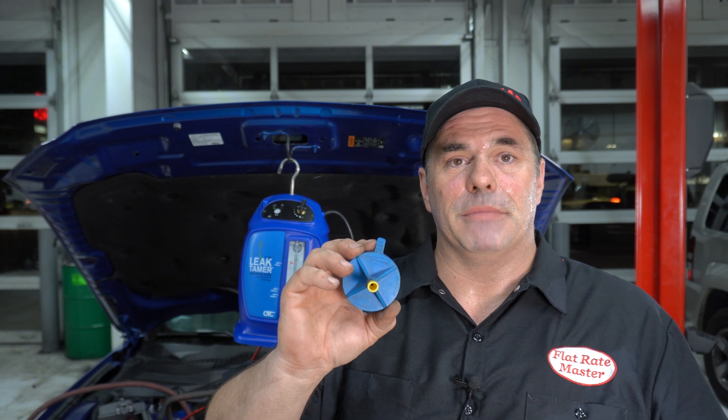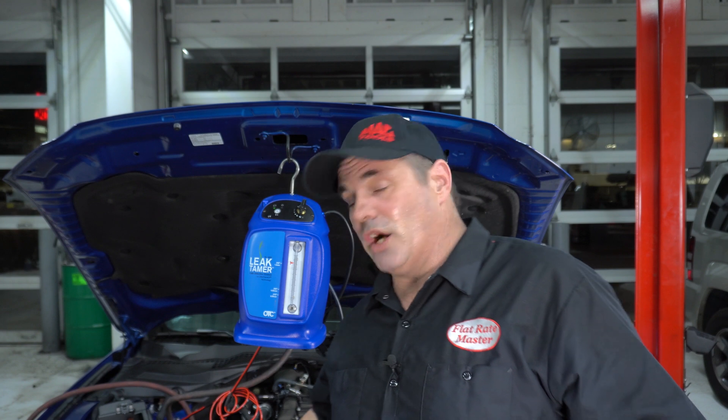The other way is that these adapters are sold to replace the gas cap, so you can go that way. Now that is my least preferred method because then you can't test the gas cap, but it is a method if you can't adapt any other way. They also have a larger size for larger gas caps. These will not work with Ford capless systems, so keep that in mind. I'll try to link them in the description or comments if I find them on Amazon — they can come in handy, but they can also be frustrating because they don't tend to stay on real well.